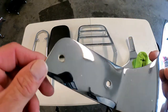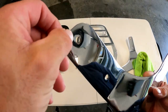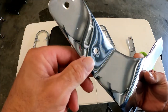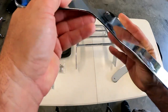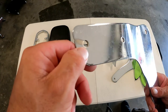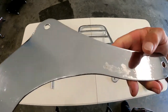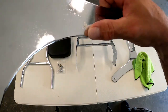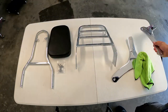The other side has no washer mark, but this one's kind of oblong at the top — it's almost like the chrome dip rolled into the hole. What's going to happen is when you put your bolt through it, you're going to scratch it and that's just going to start rusting immediately. On the inside there's definitely another mark where the chrome didn't take — it's pitted really bad. There's a big area where the chrome didn't take, probably a bad weld or bad grind.